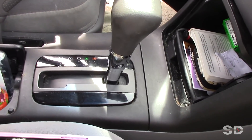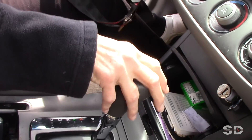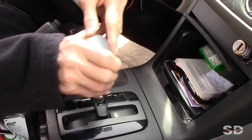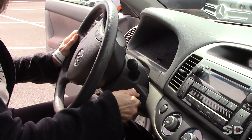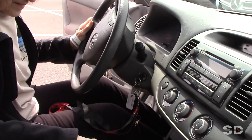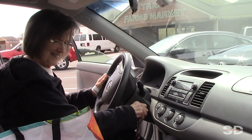All right, the next thing I told her over the phone — let's see if this thing will crank in neutral. We're checking your park/neutral switch real quick. Shift into neutral, okay, and then go ahead and crank it. Nothing there. All right, go back to park. So it looks like maybe the starter, starter cable — something. I'm going under the hood.